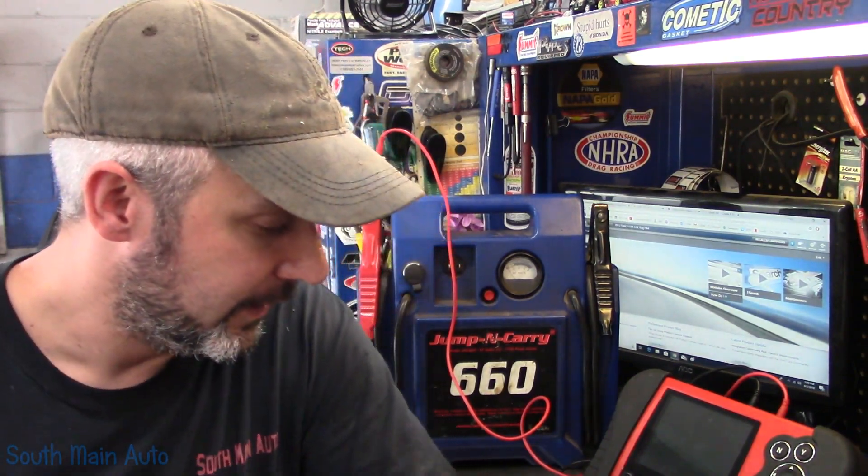I'm sure I'll just keep these around or maybe give them to Josh to use or something like that. But anyhow, comment box below — go down and leave your comments on what you use for substituted loads, how you make your own homemade test lights or various load devices. I've seen guys use big glass bulbs, headlight bulbs out of cars. I've seen guys use horns — they say we're going to check the fuel pump circuit, grab a horn, throw it on there, hit the key, see if that little guy blows. Gives you kind of some use of different parts of your senses. Comments below — thanks for watching.